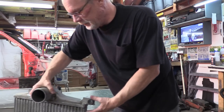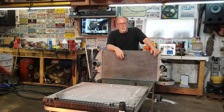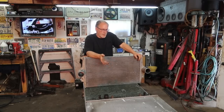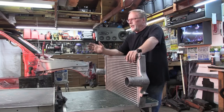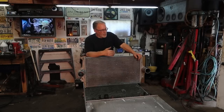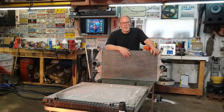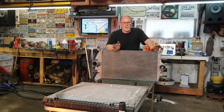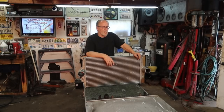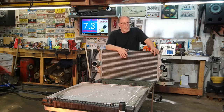Next on the list, your air-to-air. Obviously, OBS, we don't need to worry about this. You didn't have this, but if you have an air-to-air unit in your truck, this is where the finer debris that works its way through that AC ends up in here. And I'm here to tell you, this really gets crudded up on 20, 30-year-old trucks. If you haven't spent any time cleaning this and running a power washer through, you gotta get her done. And the best way, set aside a weekend, empty out the radiator, pull the radiator on out, get this unbolted, it's not difficult at all, and pull this on out,